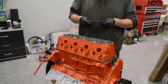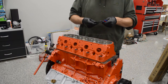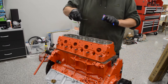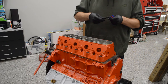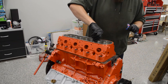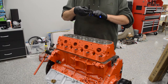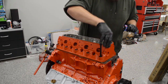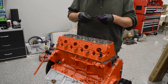Proceeding with the bolts — we're just going to put the long ones in for now. Don't worry about the little ones on the top; once these are done and torqued, the pattern has you do those ones last. Try not to lose those washers down in there because you'll be taking the pan back off.